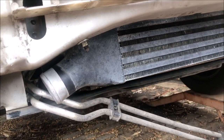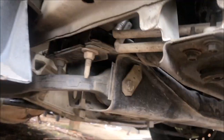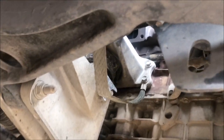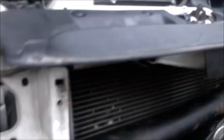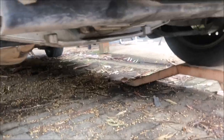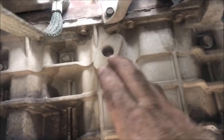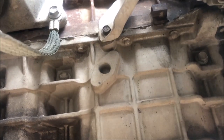I don't want to touch the cooler until I work out where that pipe goes — I've got no idea, I can only guess it goes down and under there. So I'll leave that until I get the pipe. Let's go up top and do what we've got to do up here. I think it's time to throw Mr. Turbo on. Once he's installed, we've got to go down underneath and modify the sump. The NA has the same sump as the turbo except where the oil return line goes in — it's not drilled or tapped — so that's one of the jobs we've got to do.